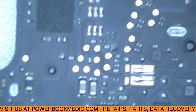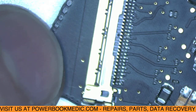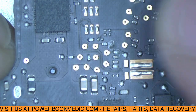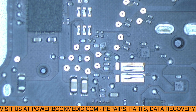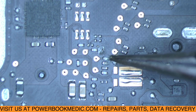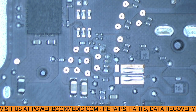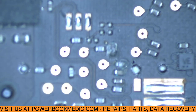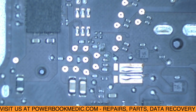This one is liquid damaged, and I'll show you why. Looking under the microscope, you can see some components here at the top related to your display — the display connector is on the other side of the board. You have this resistor, this fuse, and these capacitors here that are liquid damaged. You can see the corrosion going on around that resistor especially, so that's one area we're going to have to pay attention to when replacing parts.